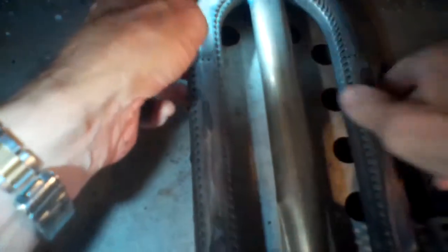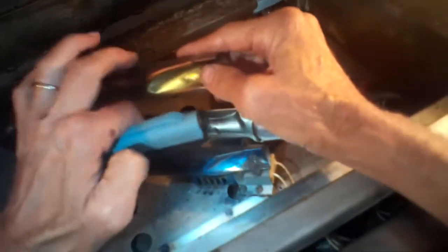I'm just spinning off this quarter-inch screw at the end of the Venturi tube. Now just hold it and turn it out away from the oven, then turn it on the side.